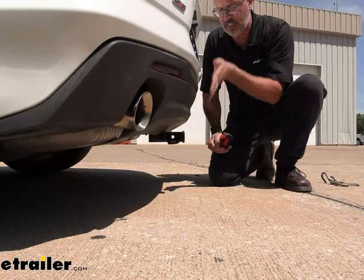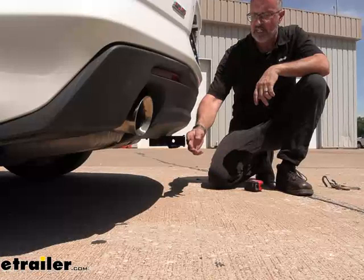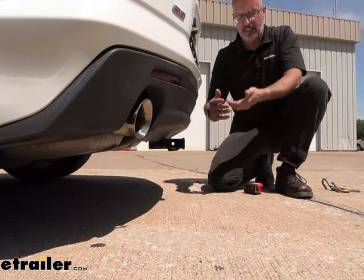These numbers are important when you're choosing accessories like a ball mount — if you're going to do some light towing, you'd want one that comes out and has a rise to it. Or for accessories that fold up, like bike racks and some cargo carriers, you want to know that when they're in the stowed position they're not going to impact the back of your bumper.